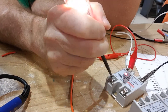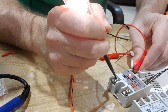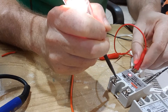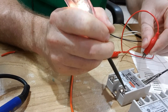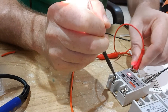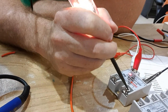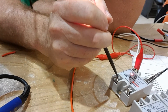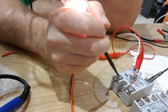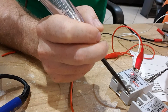The short is most likely on that side rather than this side. The relay is actually switching, but this side here has the hard short — and that's a big problem. It makes the relay useless.